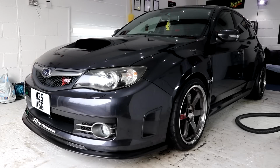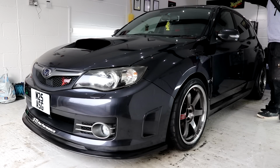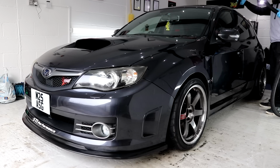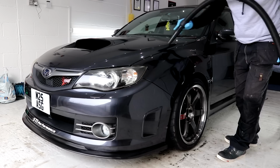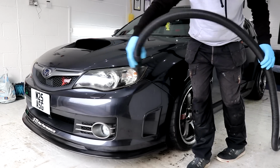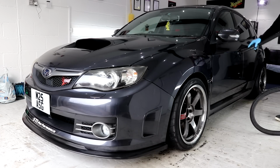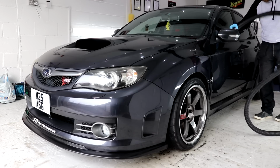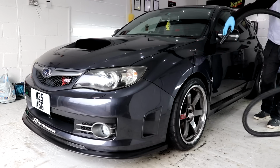Another one of my personal favourite parts of detailing is blow drying the gaps, crevices, door shuts and sills, filler cap area, grills, wing mirrors and generally all of the areas where water becomes trapped. When we move to machine polishing and particularly the ceramic coating stage, the last thing that we want, especially when trying to stick down our detailer's masking tape, is trapped water dripping down the paintwork, also making that masking tape impossible to stick.